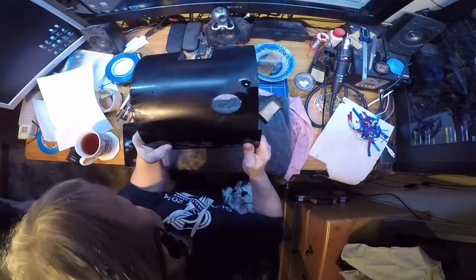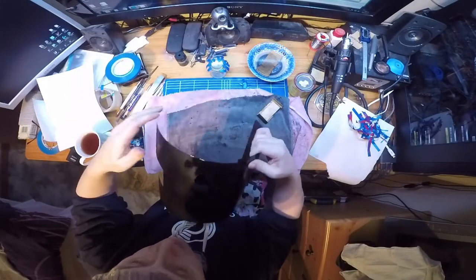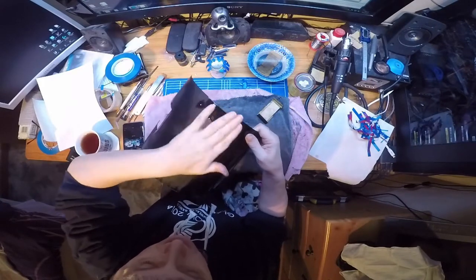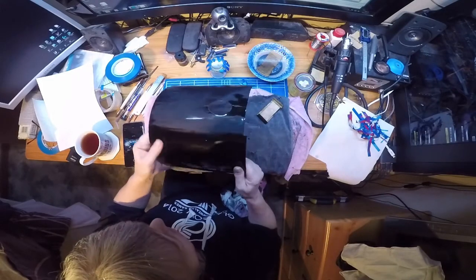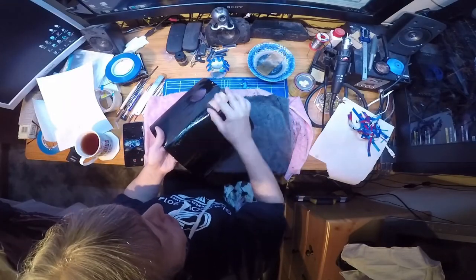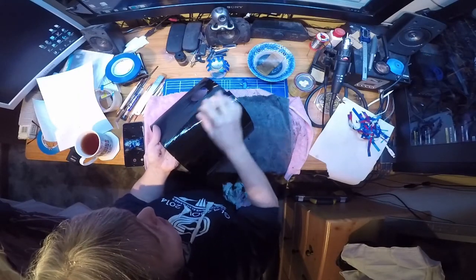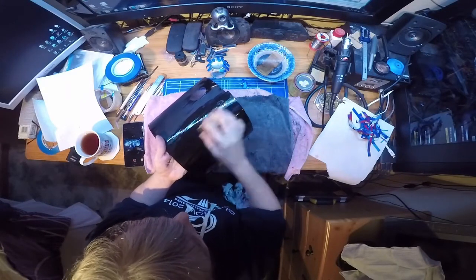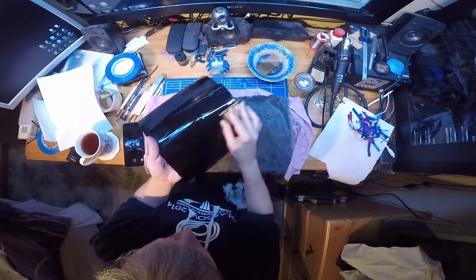So as you can see, we're taking the shine off because that then lets the paint stick better. And round here there's a little shaping around a bolt or something, so we'll do that by hand. And the little pits. So we just keep going at that. And I'm putting very little pressure on the block. I'm just letting it skate across and do its job. Because when we come to clear coat, that'll bring all the shine back up and seal everything in.